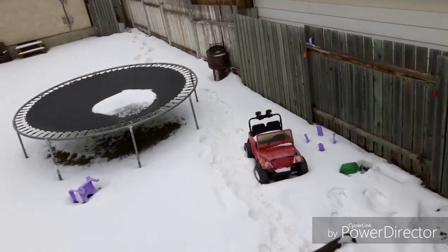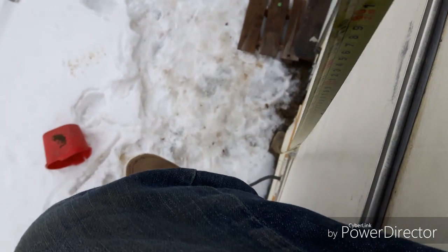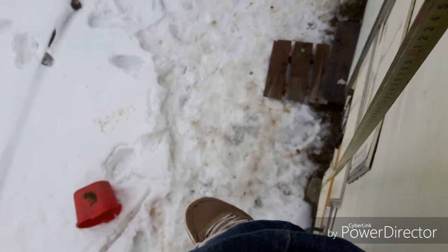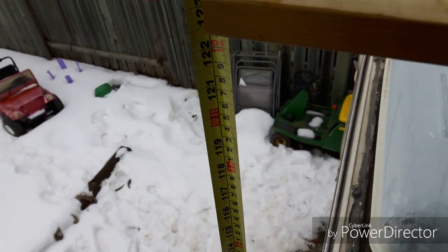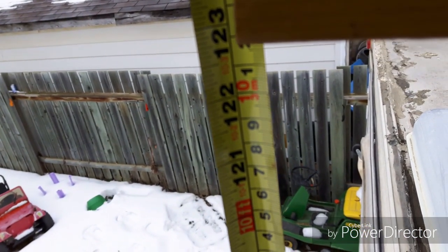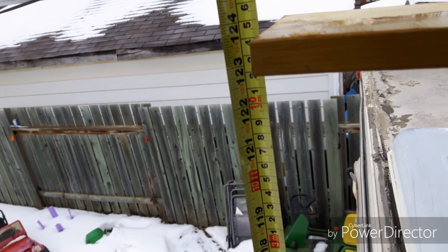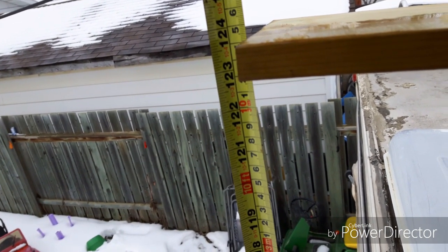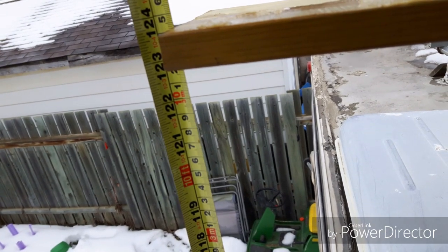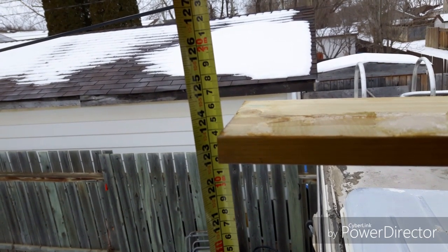I needed two hands so I put the camera down. As you can see, the tape measure is sitting down on the ground — on the concrete blocks the motorhome is parked on, which simulates a road surface. Looking at the tape measure, it reads ten feet, one, two, three and a half — so ten foot three and a half. I'm going to round that to ten foot four inches, and I always like to add two extra inches, so ten foot six is my safe height.